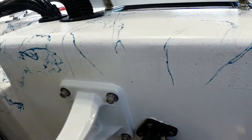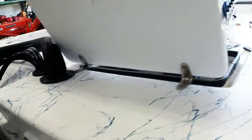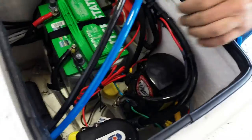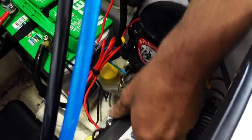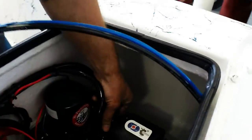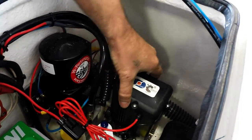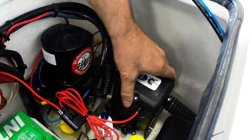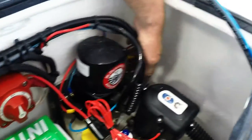They've taken 5200 to all the holes here so that you don't have any water intrusion. Gary, we didn't have much room here so I was able to wiggle this pump down in here and mount the bracket and put a piece of bilge pump hose right here so it doesn't rub on the hydraulic lines for the jack plate pump. Everything wired directly into the battery switch and the ground over here.